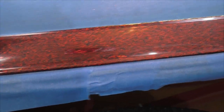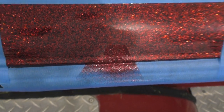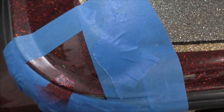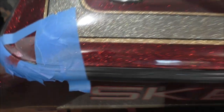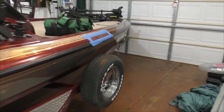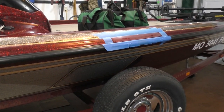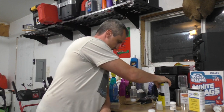I'm going to get back once I start taking all this tape off and actually get into the buffing and sanding. That's how you do these small repairs. You can kind of see right there is where that repair is — the reason it looks darker is because I sanded that area; you don't want that area shiny. I can see where I did that one and I think I'm going to blend that edge. My second coat is going to go in here and that's how I'm going to blend it.